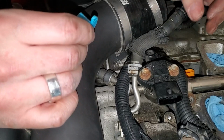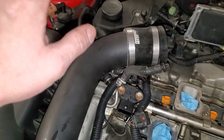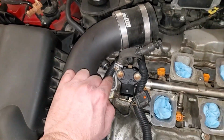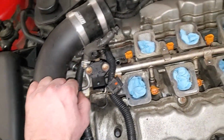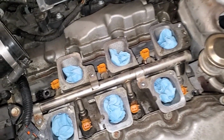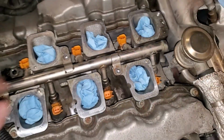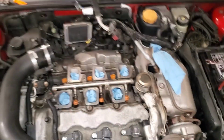Oh man. So I'm having some complications with this lower fuel line. Unfortunately, these DO88 charge pipes are less than ideal for this. And I've tried to snake a fuel line kit in here and I just can't release that clip. So my next goal is going to be to unclip each of these injectors, kind of lift this fuel line up to get this lower piece out.